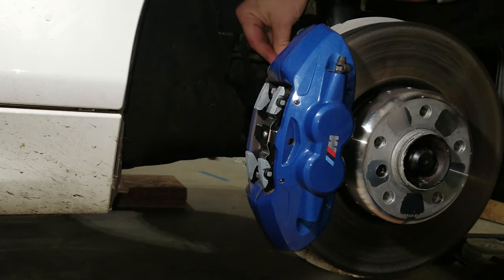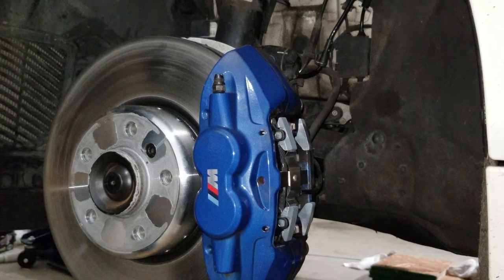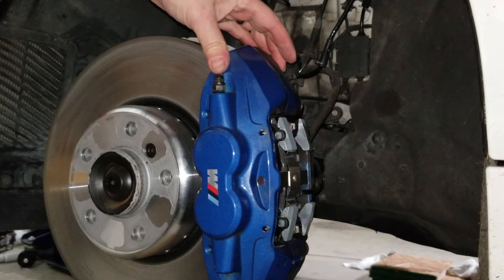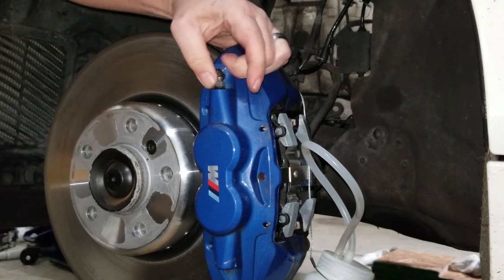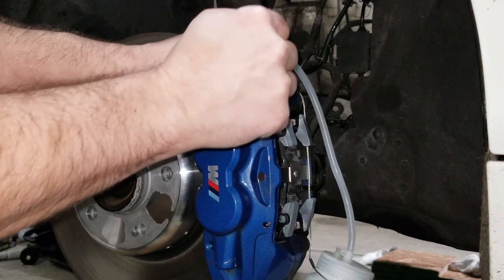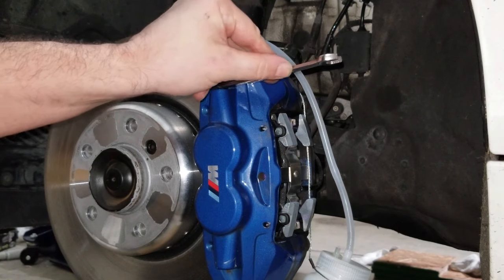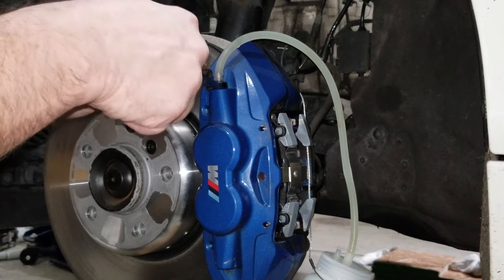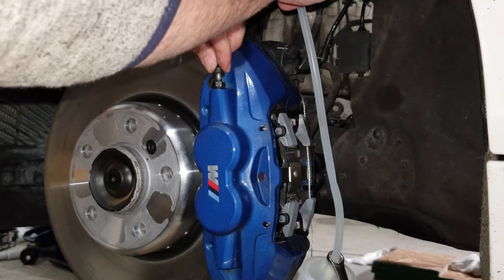Make sure you check the bottle for pressure and fluid. Just like the front on the other side, you need to start with the outside portion of the four piston caliper first. Color change came pretty quick on that — it only has a couple of feet. Put the cap back on.